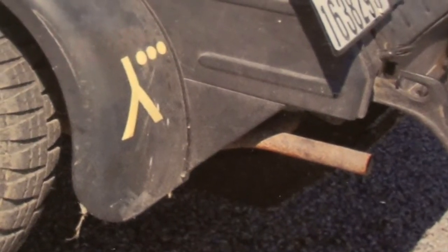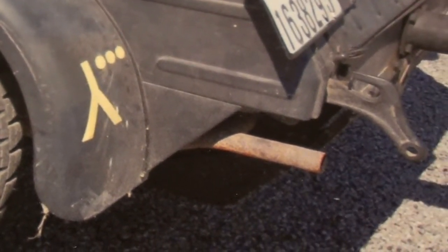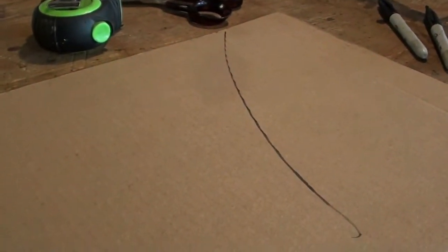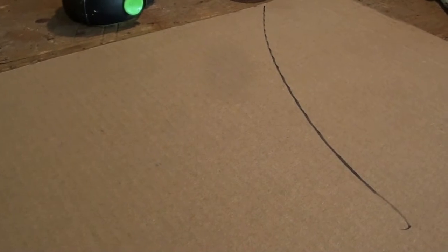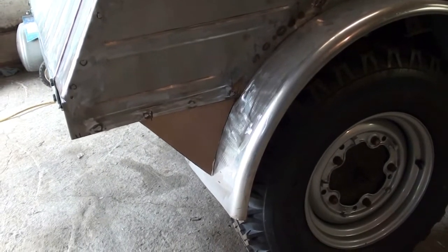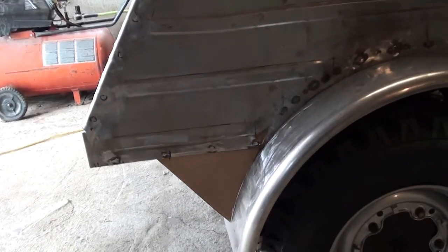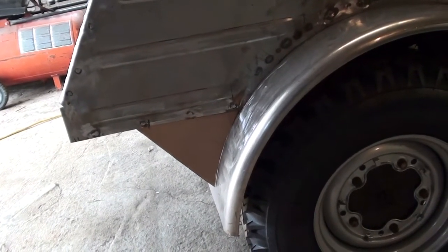So that's what I'm going for, just a little triangular piece and it has a curve there to match the fender. I'm going to start by tracing that curve there, cut that, and then make a pattern out of cardboard and try to get the proportions right. Once that's done I'll have a better idea of where to cut the fender. So now I know exactly where I want to trim the bottom of the fender. The measurements of the Kubel aren't precisely matching the original, so at this point when it comes to details like this it's more about just eyeballing it, getting the right look.